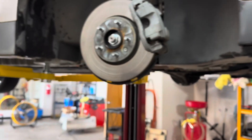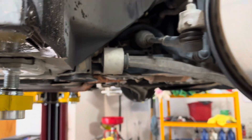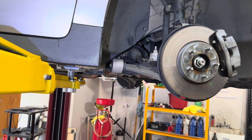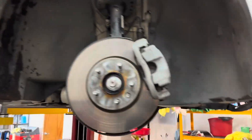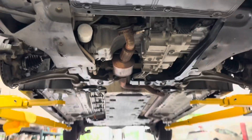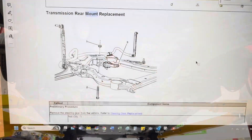That's it — tips and tricks for the Gen 1 Volt rear trans mount. Don't drop the subframe — just loosen the steering rack bolts and move the rack forward to get that bolt out. Hot tip! Check us out online at hybridandelectriccarsales.com or see us in person at 616 Bradley Court in beautiful Franklin, Tennessee. Hope to see you all!